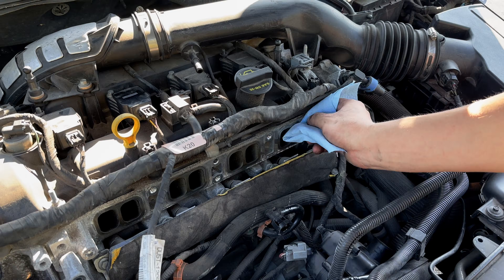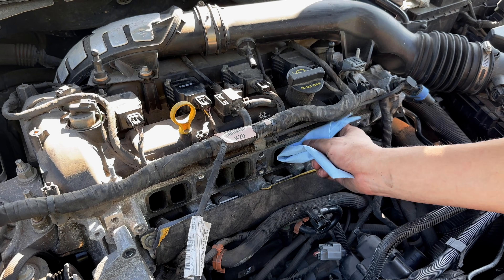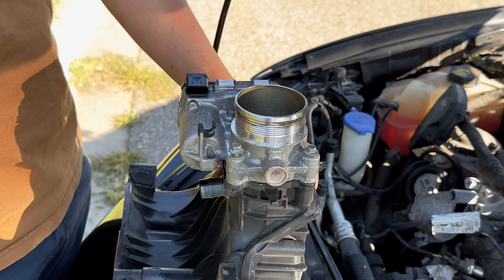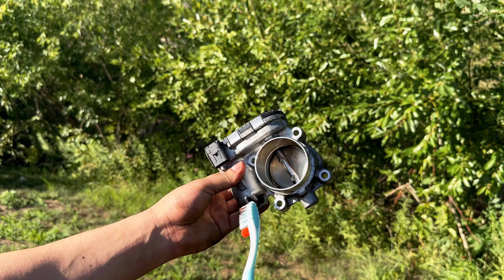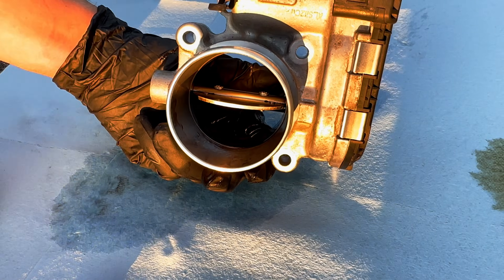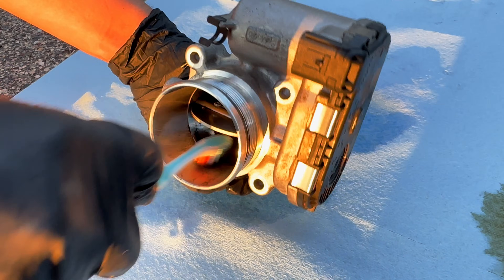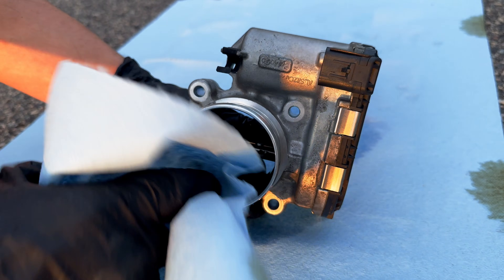Now I'm going to clean the surface of the intake ports using a shop towel and throttle cleaner. To thoroughly clean the throttle body, I'm going to remove it from the intake manifold using a 7mm socket. Make sure to use the throttle body cleaner — spray it onto the throttle body and clean it with a toothbrush. You also want to open the butterfly valve very carefully and clean everything thoroughly. After you've got most of the gunk off, grab a shop towel and finish cleaning the throttle body with it.